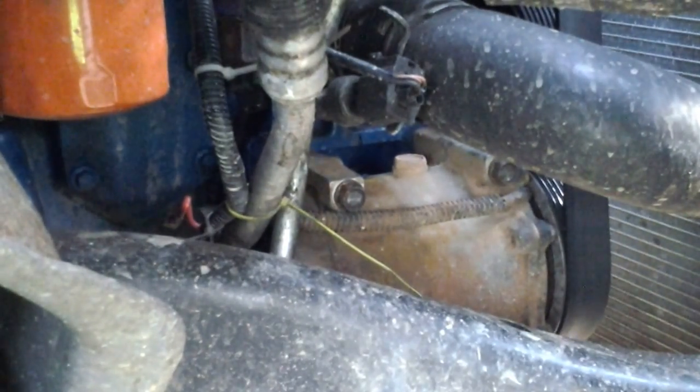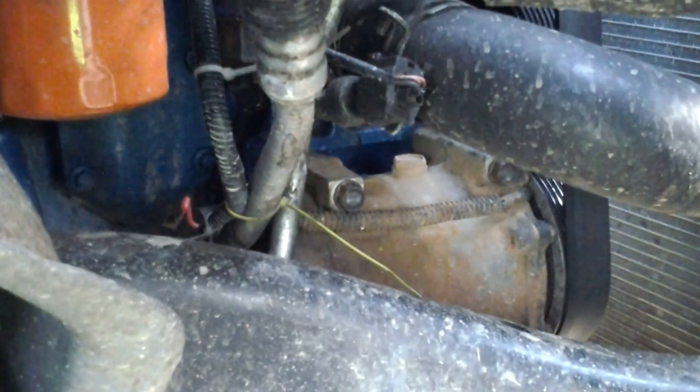The back of the compressor has a different electrical connector, so you're going to have to make a little pigtail. You can do that fairly easily — if you want to cut the wires off the back of your common rail compressor, it will have the right pigtail to match your wiring harness. I didn't want to ruin a perfectly good compressor, so I just made a little jumper with a red and black wire to go from my factory pin to the 12-valve AC compressor.